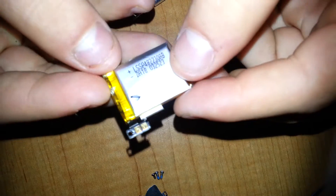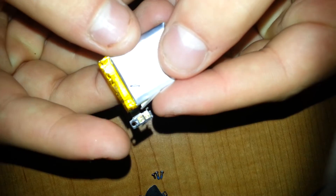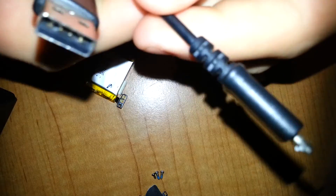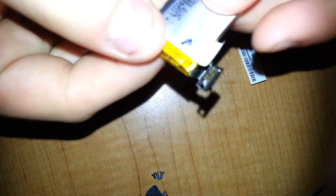You can do that, or you take this separate lithium battery — on the two leads it labels positive and negative. What I did was take a USB brick, a USB-to-micro-USB cable, and cut the end, stripping it down to the red and black — positive and negative. Then I took two alligator clips and clipped the two wires to the battery. Now I know that's not a smart thing to do, but if you don't have a charger and you really want to use the watch or you're trying to sell the watch and it's dead, you can always charge the battery that way.